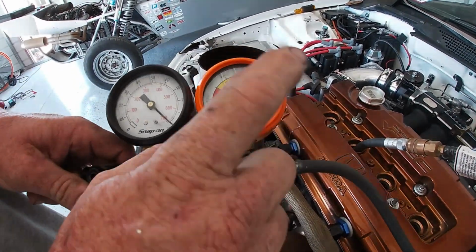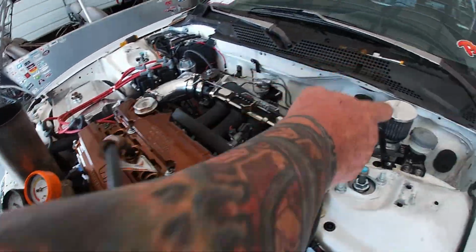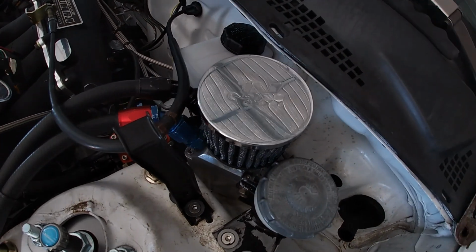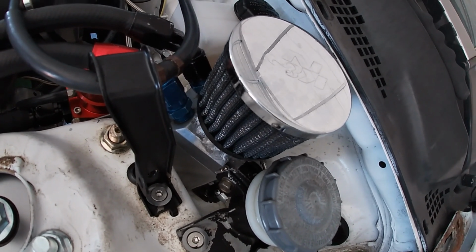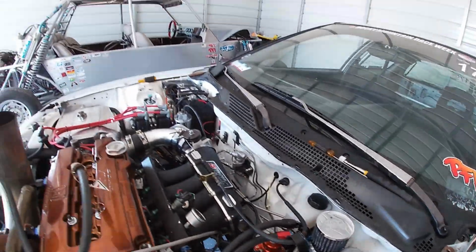All right, cylinder number 3. 100 pounds in, 15% leak down, which is really good, but we can hear it. Let me start it over so you guys can hear that. If I take the air away and I put it back in, you're gonna hear it gurgle in there. So far we're getting blow by in all 4 cylinders.